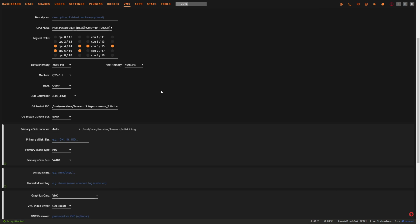So yeah, guys, as Brian was saying there, if you have the RAM, definitely give it to it. I've just bumped it up to 4 gig there, so we'll give it 4 gig. It's one thing I always recommend you guys do when you're building a server, whether it's Unraid or anything else. RAM is such an underrated thing, because after a few months, maybe even a few weeks, depending what you're doing with your server, you'll find that you're running out of RAM. When I first built my server, I don't know about you, Brian, but I started with 16 gig. It didn't last very long.